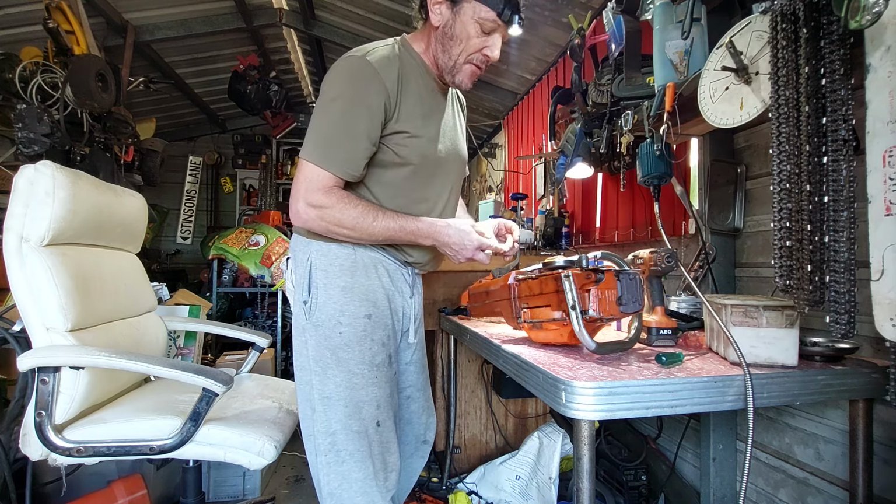Just a new oil pump, I think. It's pumping oil really good, but it's leaking. So, oh, there you go. It's all oil pouring out here. So I'll pull that drum back off again. It's all black. What I was worried about. But I can't tell what's causing it, but I think the oil pump itself's worn out.